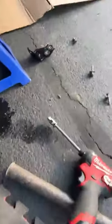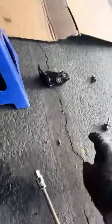And there are two steps you gotta take that I always forget. Damn, I did this one other time a while back on the same stupid model car. It's just a pain. It's really acting crazy also. So anyway, right here the bolt. Right there, you gotta take this off first. This right here goes up in there like that, and it holds the intake onto it.